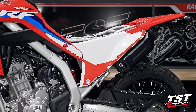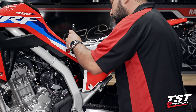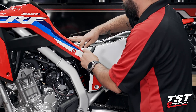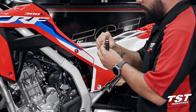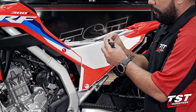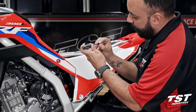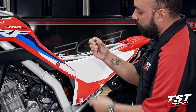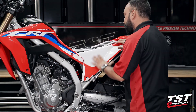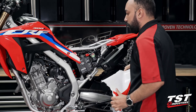Grab a small tool and apply light pressure pushing it down in the center, then remove it. This is a pretty small piece of hardware — very easy to lose. The way it works: push it gently, that disengages the locking pins allowing you to remove it. With all that removed, pull gently on the rear of this lower fairing piece and it'll come right off.